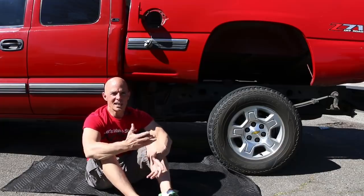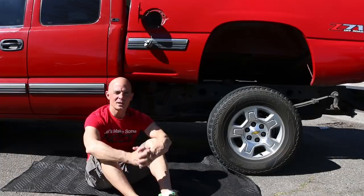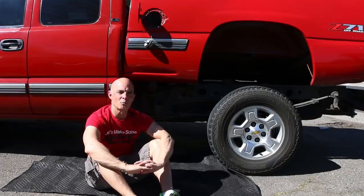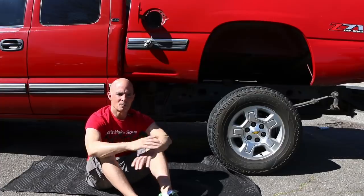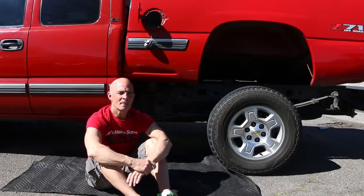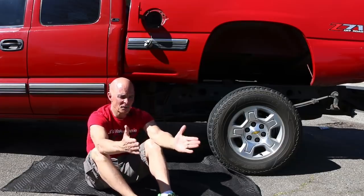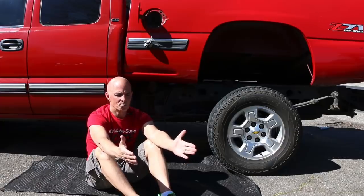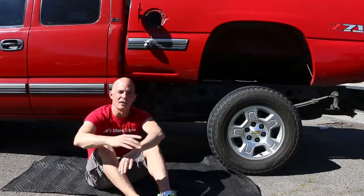So let's say that supercharger, that M90, is spinning at the speed that we spin it at, because it still had the factory 3.8 inch pulley on it. Let's pick a number, let's say it's 6,000 RPM, it's providing enough airflow. And we're going to even assume, because there's a difference, providing that blower speed on a 3.8 liter versus doing it on a 4.8.